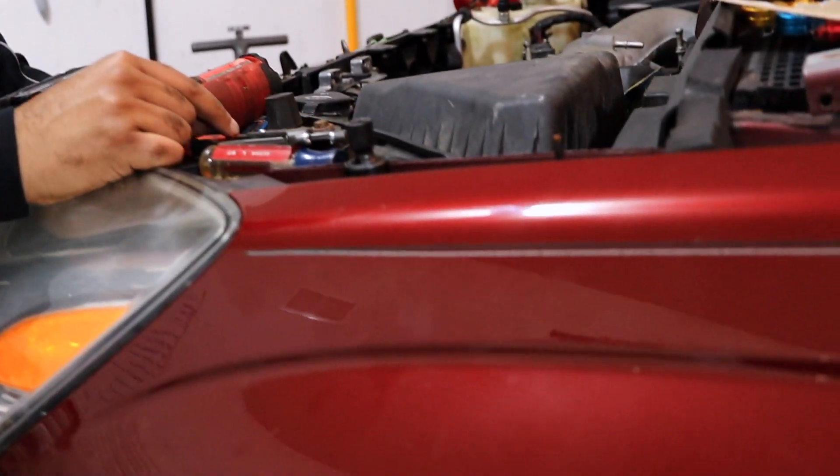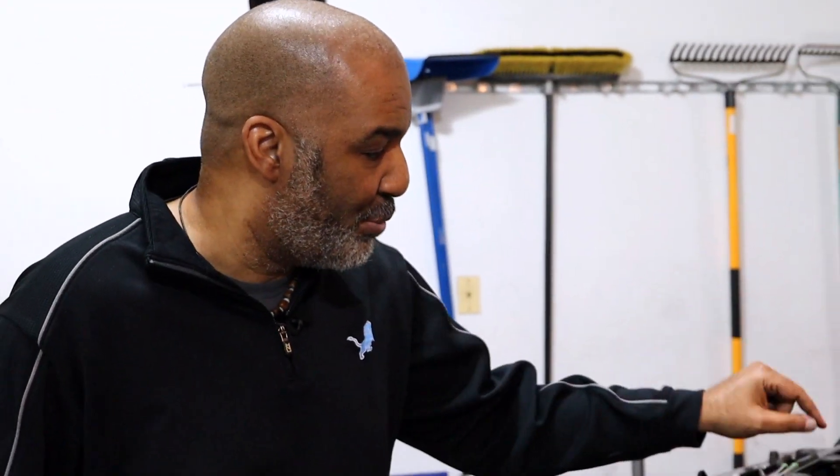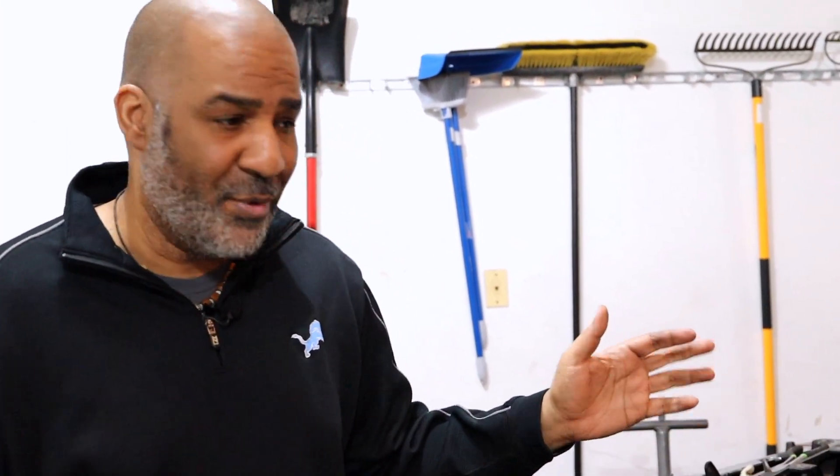This 13-year-old SUV just got a brand new engine. The systems are all set up, the battery is all charged, we got all the fluids in it, so it's all ready to get started — put the key in and start it up. But with a brand new dry engine, you need to prime it first. When you prime a new engine, especially a GM engine, you need to use specialized equipment.